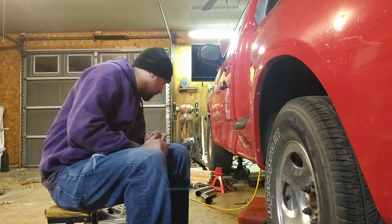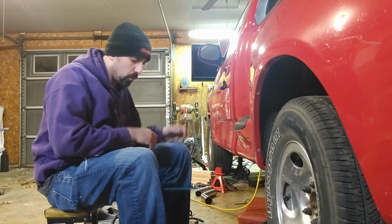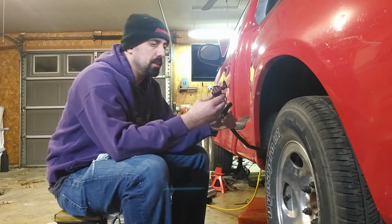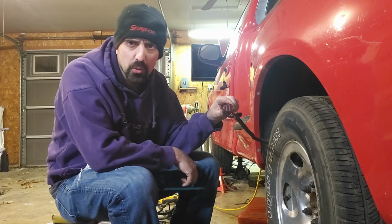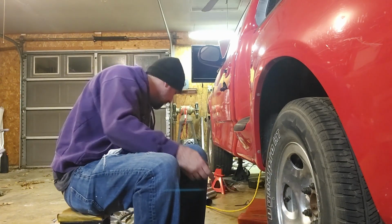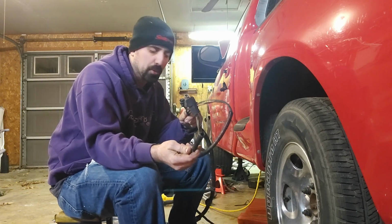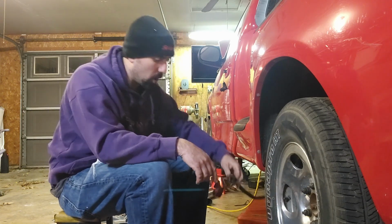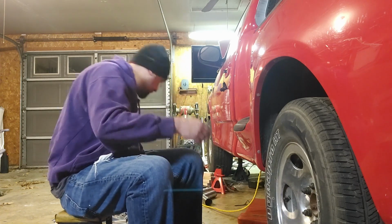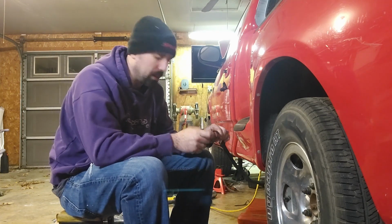All right. We're on night 2 of wiring and miscellaneous, and what we've got going on is the Lightning harness, a big singular square plug. The 1997 had multiple plugs back here for the lights. The Lightning taillight harness that we got also has just one single round plug like this for the lights. So there was an intermediate harness we did not get.